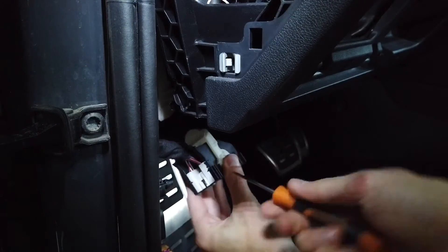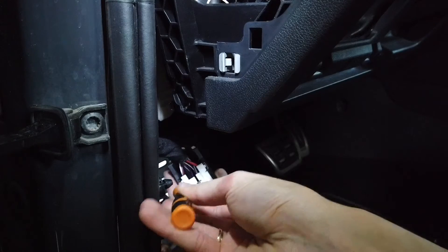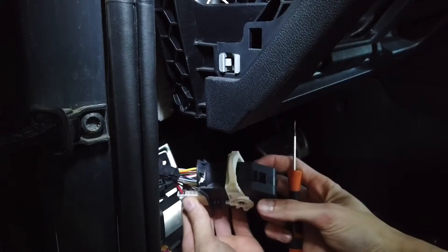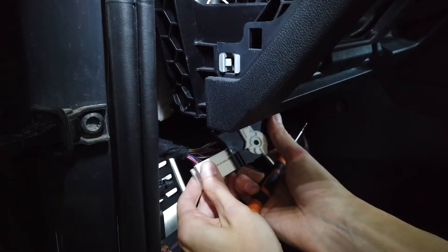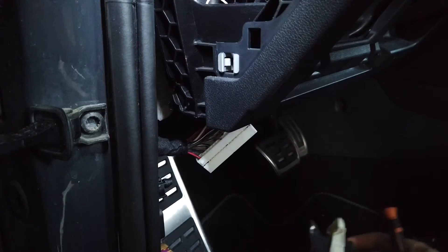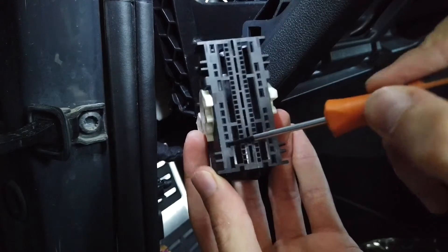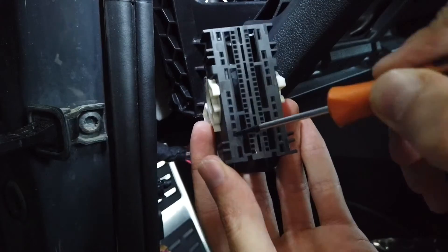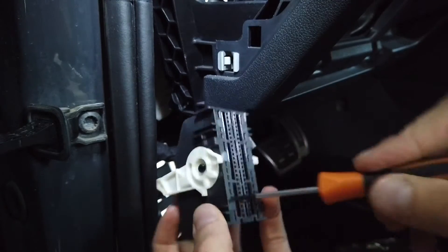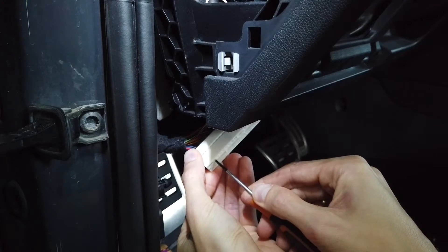The black cover is holding two clips - with a thin screwdriver I should be able to release it. Here it goes. Okay, so this whole connector goes like this, and here is pin 72, this is 73, this is the last one, and this is the empty one - the one that you should connect to the footwell lines. Since we're looking for this terminal, it should be in the socket closer to you, and it should be this one. Let's connect to it.